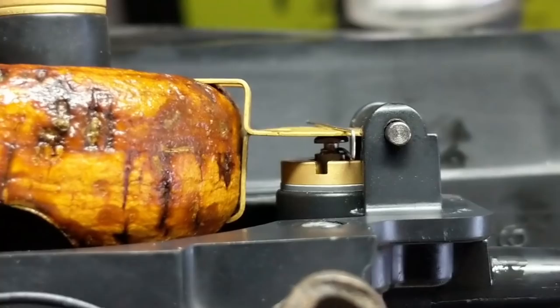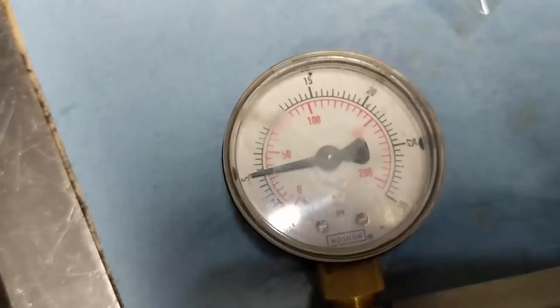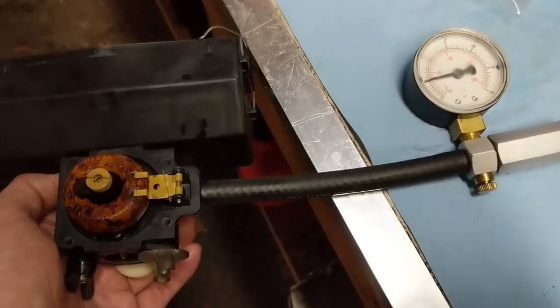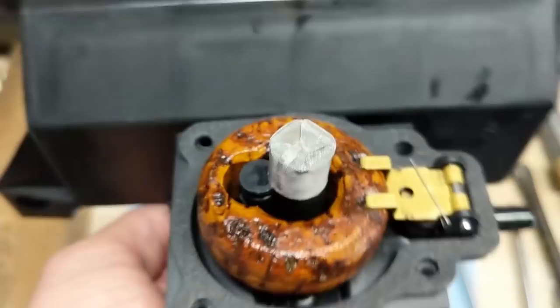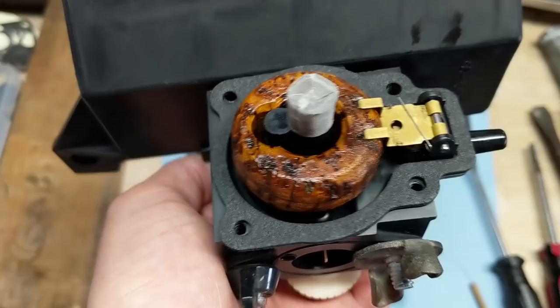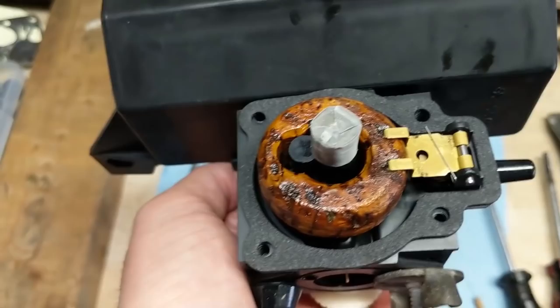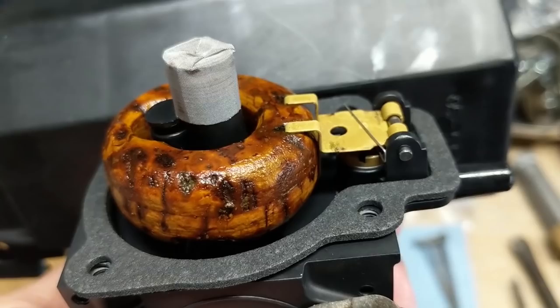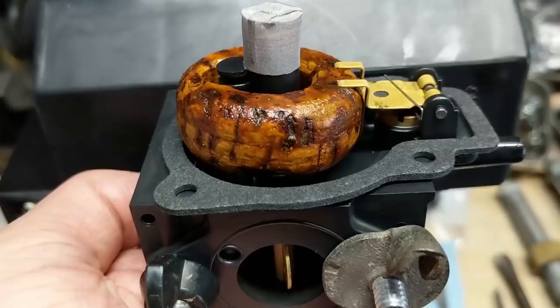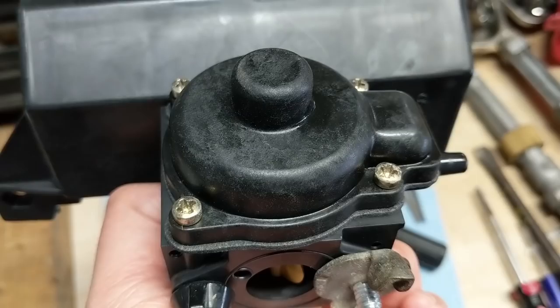I have the small plastic washer installed underneath the seat — what that does is slightly raise the seat, allowing the float to put a little more pressure on the needle valve. Pressure testing again at 5 psi: the carburetor is sitting flat and we are in fact holding at 5 psi. That means this carburetor should not leak when reinstalled. I've got my new bowl gasket lined up, and before installing the bowl, I put the cleaned screen back on top of the main jet for good flow without blockage. Remember not to overtighten those screws since this is a plastic carburetor — those threads can strip very easily.